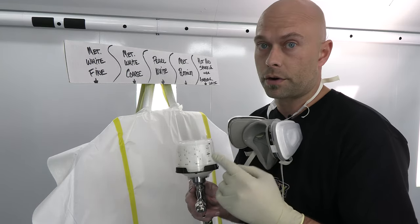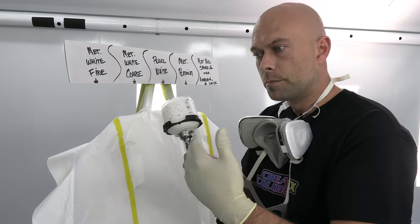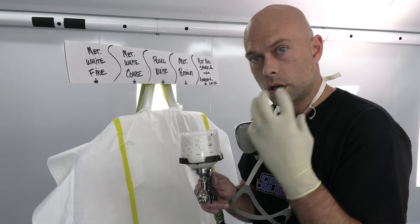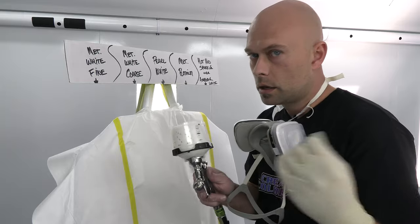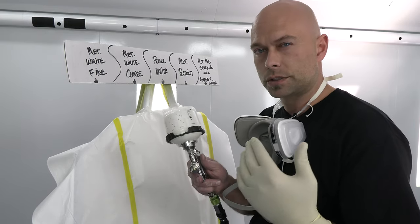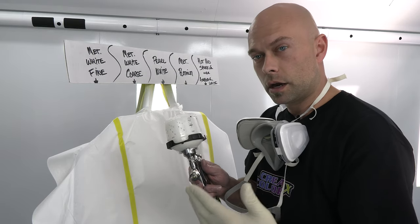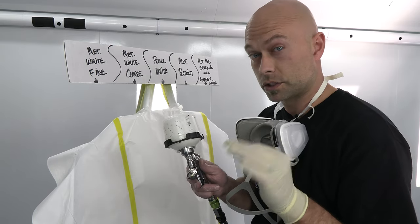The only difference is I'm going to put it on more like a guide coat, because this is essentially a wet flake — it's in its own carrier already. You're not going to get coverage with this color; you're not going to bury black or dark. Even if there was white and gray, you wouldn't cover the gray with this flake. It just kind of goes down like a guide coat. Three to four coats is really the sweet spot because you really want that glitter effect.